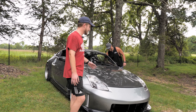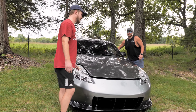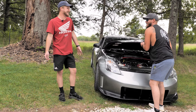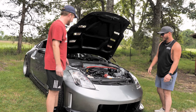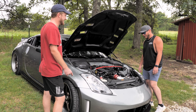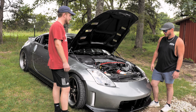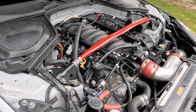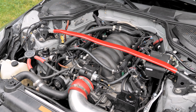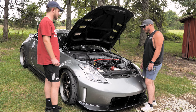Let's take a little look-see at what's going on under this hood. Pop the hood! Doesn't look like a VQ to me. No, it's not quite a VQ — sometimes I tell people it's a VQ with a different intake, but it doesn't really work very well. Pretty much, it's a really stock setup. It is an LS1 out of an 04 GTO, so pretty much just a bone stock 5.7. Stock rods and pistons, but a pretty healthy Texas Speed cam and some Gen 4 799 heads. Like I said, pretty basic motor setup overall.